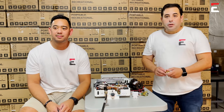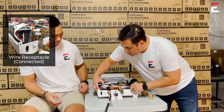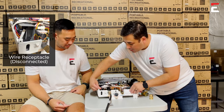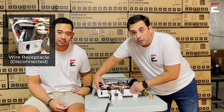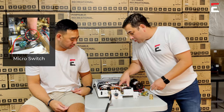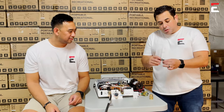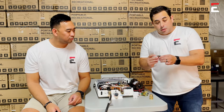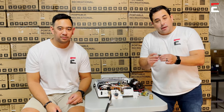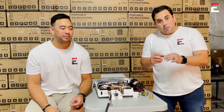We'll also look at making sure the wire receptacle is plugged in all the way. If it's loose or not fully in, take it out and push it back in to double-check it's tight. The micro switch, located right here, is another thing to look at. You'll notice there's a little lever on it — push on it and every time you do you'll hear a clicking sound. If that clicking sound happens, the part is good.